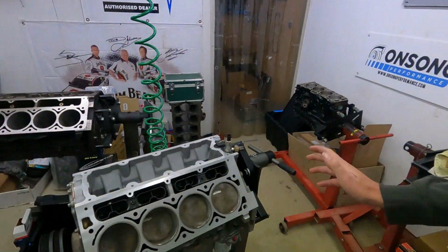The issue with sharp edges inside the combustion chamber is that at those sharp points you get a lot more heat than the rest of the combustion chamber, and if it gets enough heat in it, it can actually auto ignite the fuel and air mixture in the combustion chamber instead. Like a little glow plug. Yeah, basically. So it'll auto ignite, which induces a pre-ignition, which can obviously be very, very bad. That's very not good.